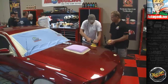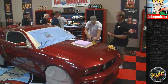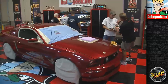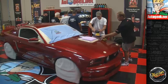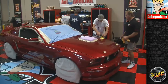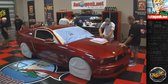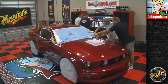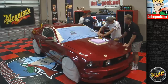One of the things you always want to see when you're buffing is a wet film of product behind you. And I would say that because we cleaned that pad so well, we need just a little bit more product on the pad there. So I'm going to go ahead and put another drop on here. Okay, there you go. Put it right back on top of there, and then go. See that little drop there? When you come up to it, keep the pad in contact, but tilt it, grab it, then lay it back down flat, and that way you don't throw a splatter everywhere.